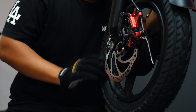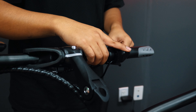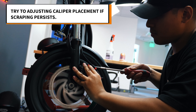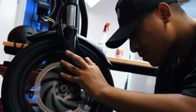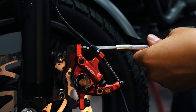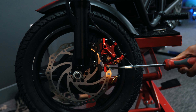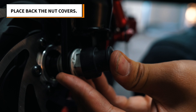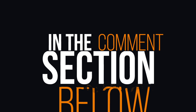If there is still scraping after this, use a piece of tape to hold down the throttle at a constant slow speed. Loosen the caliper and move it slightly until there is no more scraping, then tighten it back down once you have solved the issue. Lastly, place the nut covers back on and you're all set. Thank you for watching — let us know if you have any comments or suggestions for future videos in the comment section below.